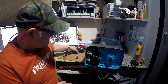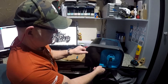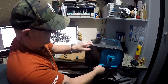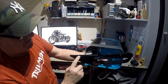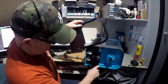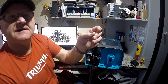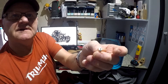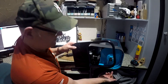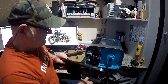In order to get into it, you pull a plastic cover off which is held in by three clips at the top - you put it in that way and push it in. There are two clips at the bottom which locate in holes: three at the top, two at the bottom. The middle one is held by a little Allen screw, so once you take that out, pop a screwdriver to push the two lugs in and then you can lift the cover out.